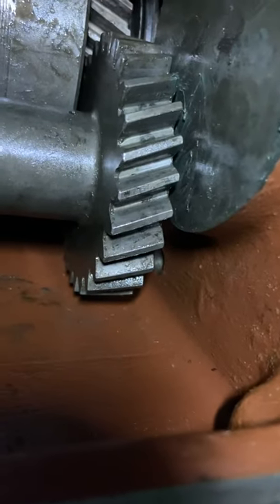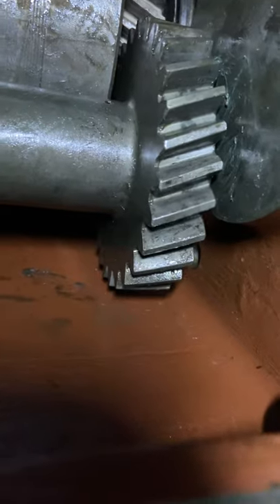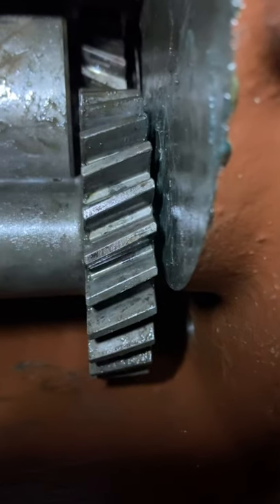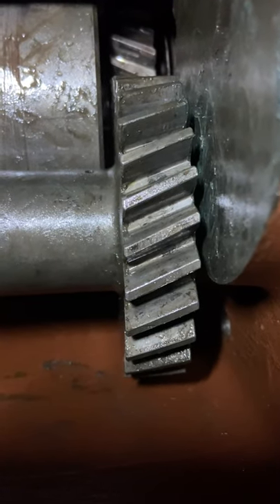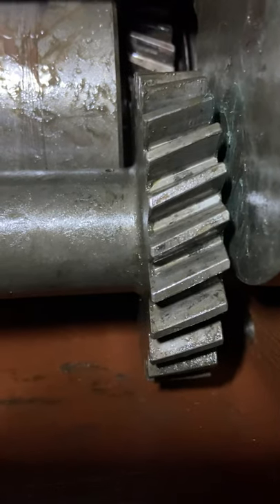This side here — this is actually the right side of the machine. You've got your counter shaft; the large gear always goes to the back. You've got a thrust washer on each end, and it is a pain to put them in. There is a plastic tool you can use to hold your back thrust washer stationary while you put your shaft in — the rod in to hold it — but I don't have that and I didn't feel like making one up.